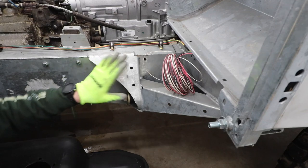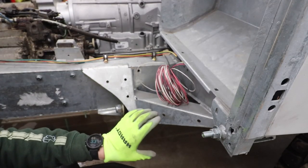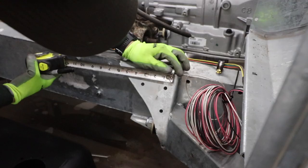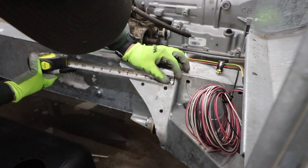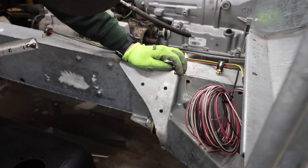The rear of the tank mounts to the chassis here and the front has a bracket coming off this trailing arm mount. We are going to remake that, but we're going to do a little bit sturdier one because we're going to have provisions for a fuel tank skid plate. We'll measure out for the plate here — we got four, four by four by triangle.